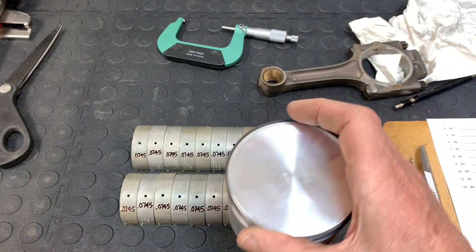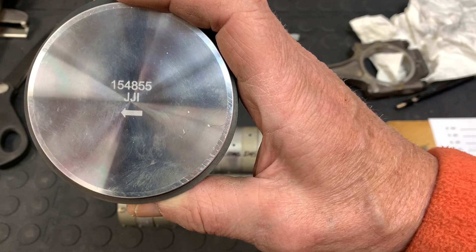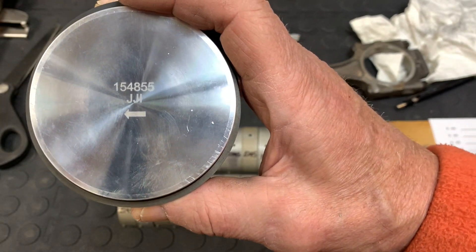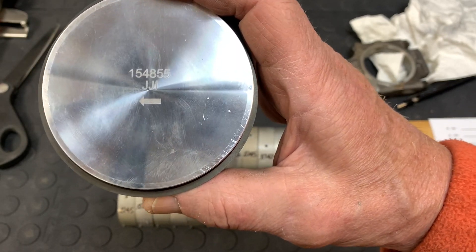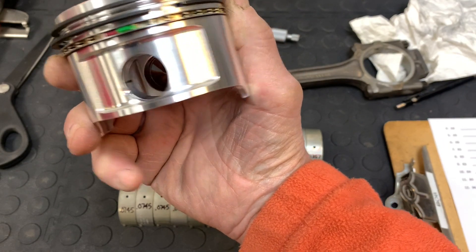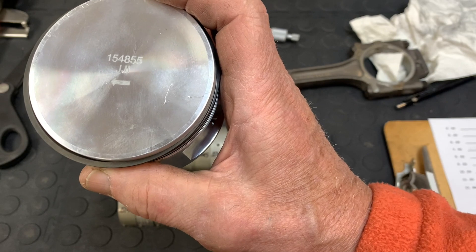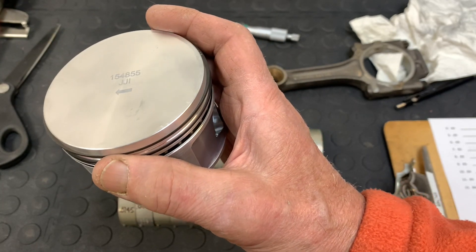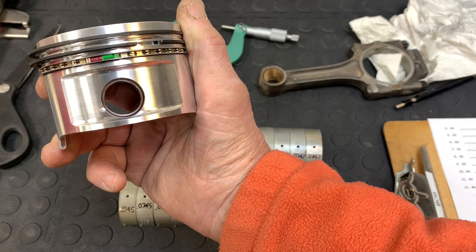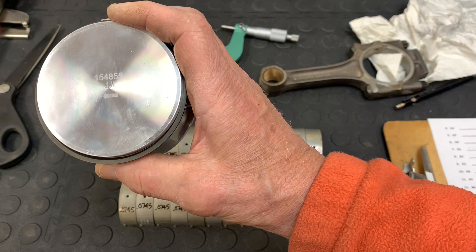Now when you're assembling the piston onto the connecting rod, there are a couple of things you need to be aware of. First of all, if you look at the top of a piston — whether it's an aftermarket or the stock piston — you're going to see an arrow, and that arrow points to the front of the engine. The reason that's there is because all pistons, except for high performance pistons, will have a certain amount of piston pin offset. In the case of production engines, that delivers a bit less vibration. The Jaguar V12 is renowned for being one of the smoothest engines ever made, and part of the reason for that is that the piston pin offset is significant — it's huge. And if you get this installed backwards, you could have absolutely the opposite effect.